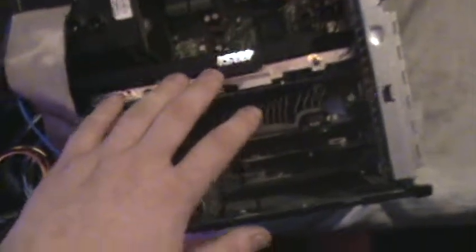I'm not entirely sure if I should do this, but — boom — it's already done. I might actually like this because there is a fan right here that will blow air across here, and this card will be able to somewhat breathe. I do need to put a fan back here. These kinds of cards don't really ventilate themselves that well — they just push air around the case, which keeps the card cool but pushes hot air into the case. So I might set up this fan as an outtake instead of an intake — basically blowing air out.